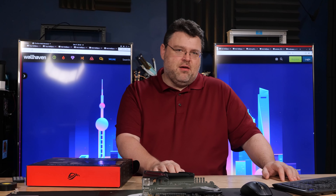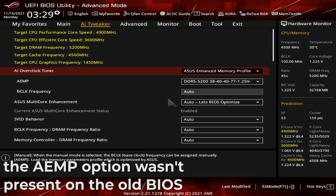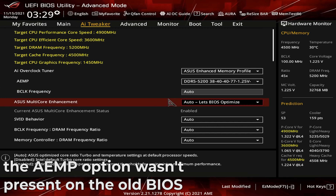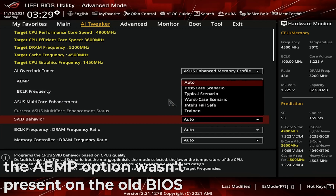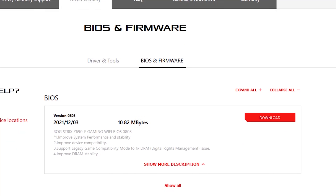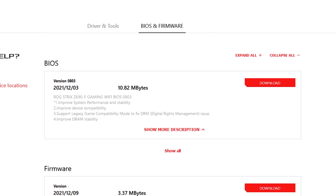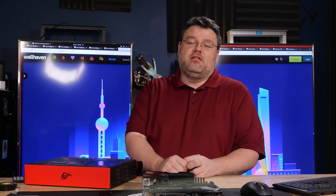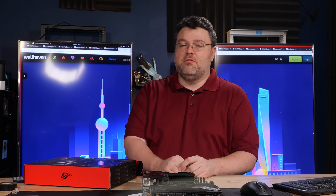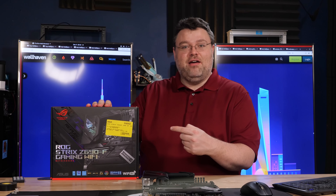Now for the return mini-game — I was hinting about it. Did you figure out why it was returned? Well, this motherboard out of the box had BIOS version 0407. BIOS version 0407 I don't think was ever meant to see the light of day — there weren't even any XMP options or DOCP options or anything to do with memory tuning. Basically it's a will-it-boot situation. Fortunately, ASUS had more up-to-date BIOSes on their website. In fact, 0407 is so old it's not even on the ASUS website. Maybe Micro Center was expected to update these before selling them. I have a feeling somebody bought this motherboard, put their CPU in, maybe got some DDR5 RAM, and nothing worked. Because there was nothing actually wrong with the motherboard — and I did not have to RMA it — but I did save a few bucks because of the yellow tag from Micro Center.